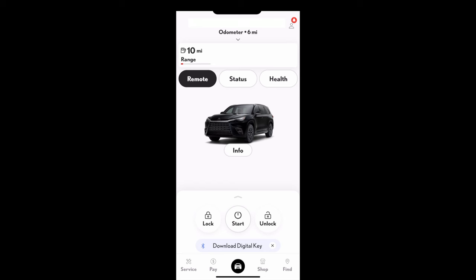The new kick sensor system is a little more forgiving — if you waggle your foot a bit and step out of the way, it's probably still going to open. But if you're not having success, just make sure to kick and step back. Don't hold your foot underneath and don't wave it side to side. If you hold your foot under the bumper too long or don't step out of the way, the operation will cancel and you'll hear a double beep. One beep means it's seeing your foot; the double beep means it's canceled. It's really looking for a simple, straight kick forward and back.